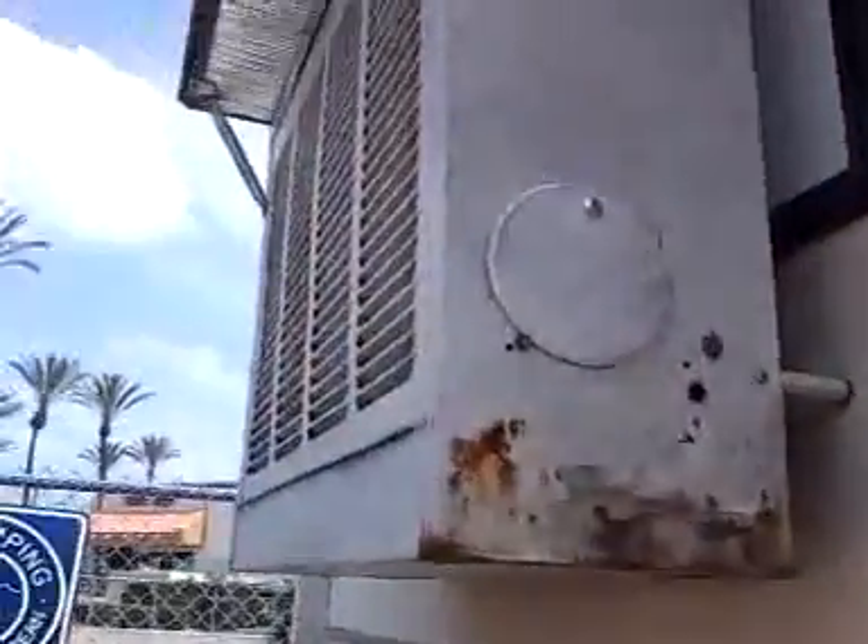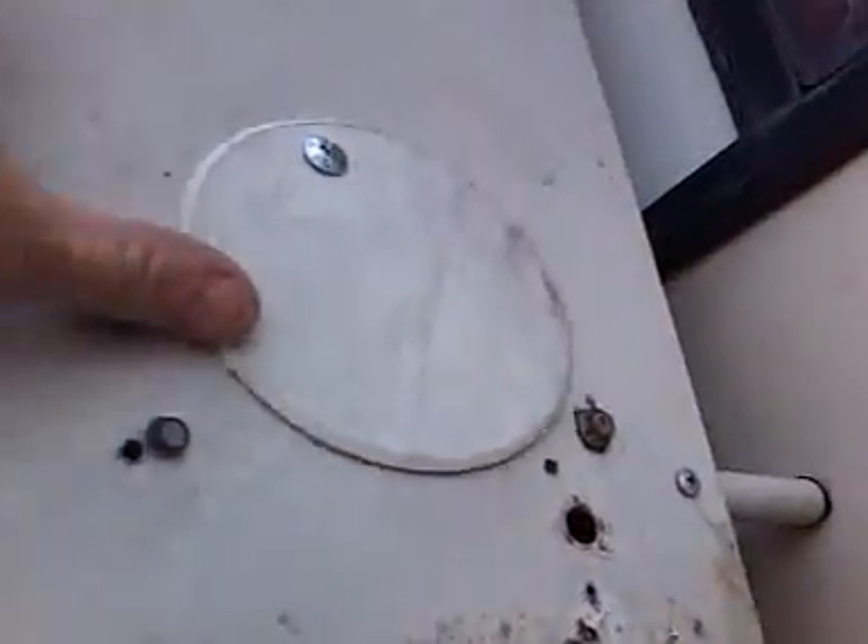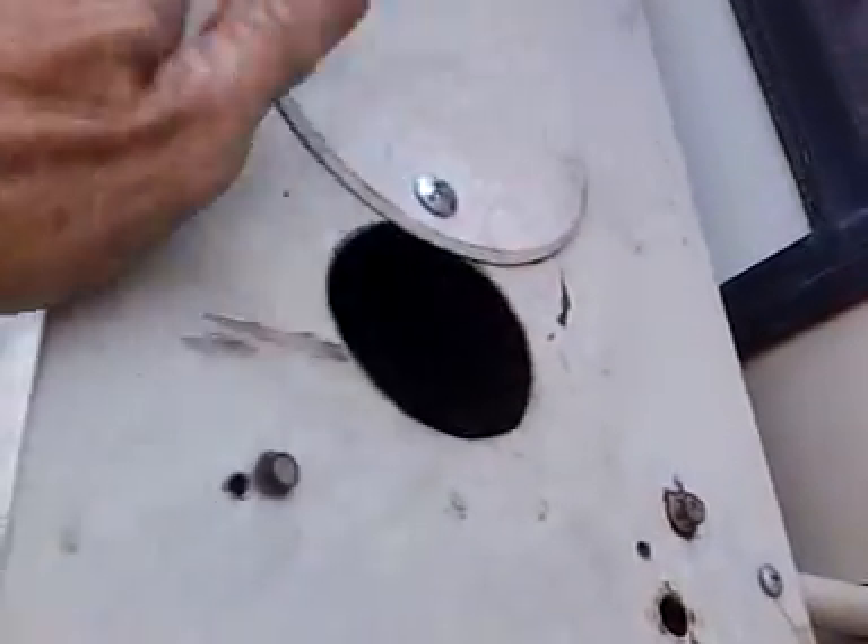It's kind of hard to stay with anybody with my dogs, so I do what I can. My friends help me, people give me stuff. The guy on Craigslist gave me this old swamp cooler that was rusted out. What I did instead of trying to run the pump, I just cut this hole here in the side — that's where I pour my water in. And I changed it over to a 12-volt pump inside and 12-volt fans from Walmart, which I'll show you in a minute.